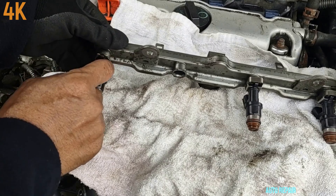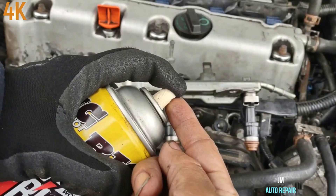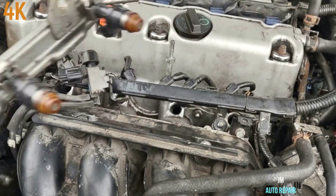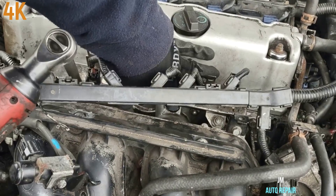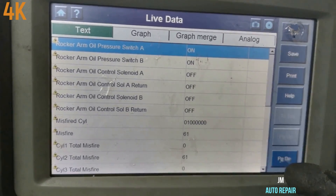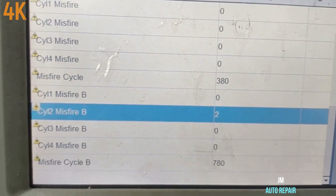So this comes here, and the one that was here goes right there. Now do the same again — very little, do not put your finger beyond this point here. Make sure you don't make contact with oil on this part at all — just the ring here. I'm gonna turn on the vehicle. And cylinder number two is misfiring right now. The misfire moved to cylinder number two — that tells me that the injector is having problems, either it's clogged, most likely clogged. Injector number two.